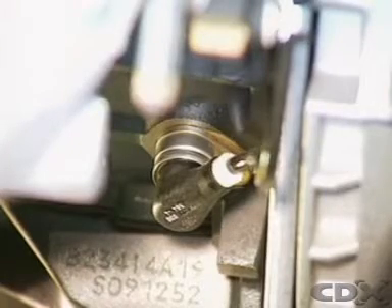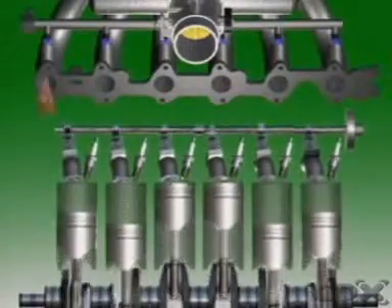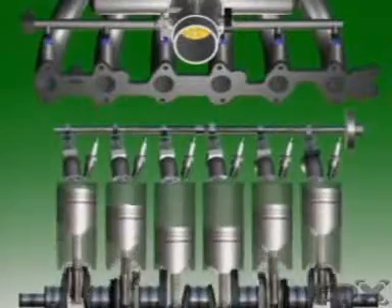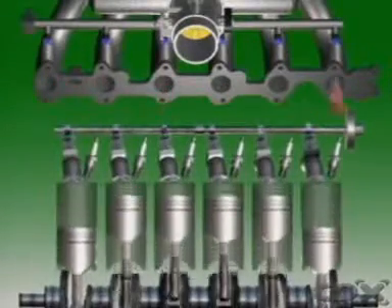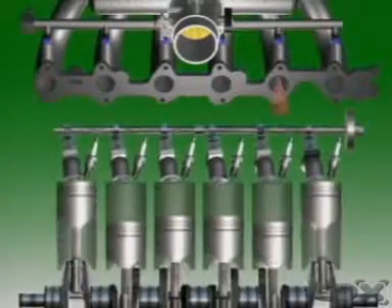When the sensors are on the crankshaft, a separate sensor is needed for camshaft position. It identifies when to commence injection for the number one cylinder, and injection for the other cylinders then occurs in the same sequence as the firing order.